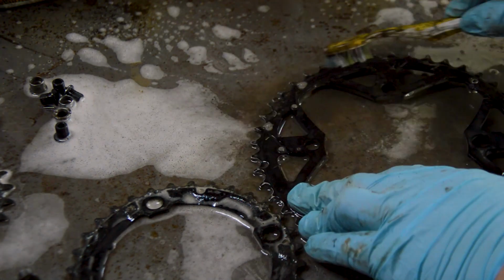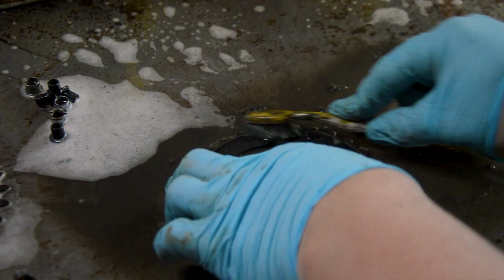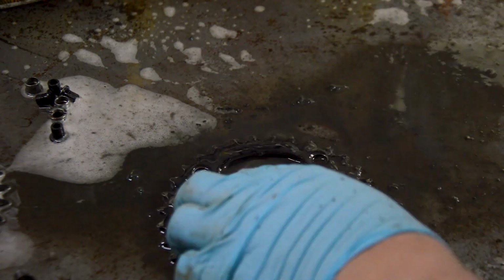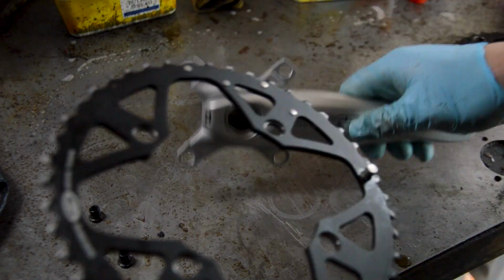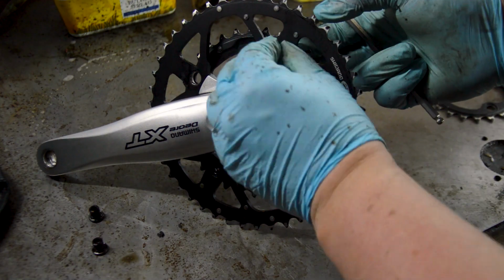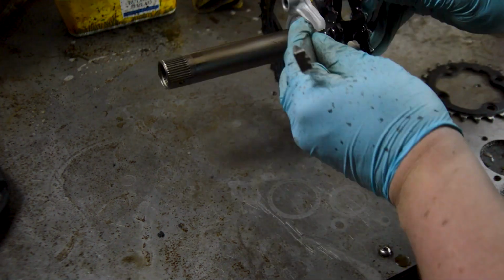I've chosen to use an AirBike 29er rigid fork that gives me an axle to crown of 440mm. It's slightly less than the Tourer at around 480mm, so it will change the geometry slightly. I very crudely worked out the angles of the head tube and seat tube with the Tourer, and it came out to 68 degrees for the head and 71 for the seat. Dropping the height with the rigid roughly changes the head tube to 71 degrees and the seat tube to 73 degrees. That's all measured from a horizontal plane between the axles, by the way. Still, it's a little bit of info for the geometry geeks. That's if I've measured it right. In theory, the bike might feel a bit better climbing, but will feel a bit twitchier at speed.